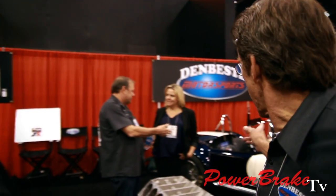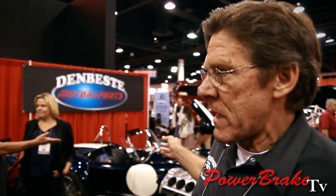Do a lot of Cobra customers like automatic transmissions, or are they traditional 4-speed guys? We actually have put a lot of automatic transmissions in these cars. We just recently put one in a car — about a 600-horsepower fuel-injected FE — sold to a lady, with a modified C6 transmission. Our small block cars, we usually use a C4 transmission if they want automatic. Normally, we would put a Tremec 5-speed TKO 600.